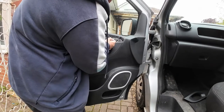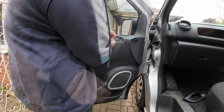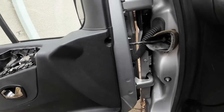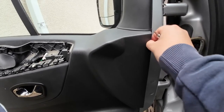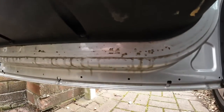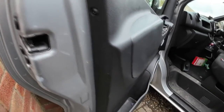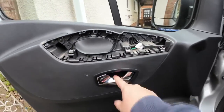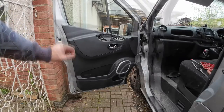We've got another T27 just up there, and I believe these are the two main ones that will be holding the door panel on — the rest just go around the edge. So switching to the T20 now: you've got one just in there. Following the door panel down, there's one there, another one there, and then one at the top — so there's only actually four T20 bolts around the whole panel. In total there'll be six: two T27s and four T20s.